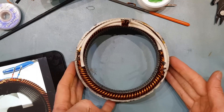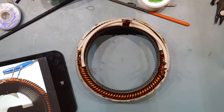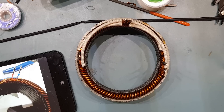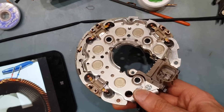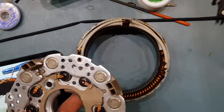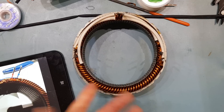So this is now a 320 amp alternator. Total cost: 50 cents worth of wire. This was a 150 amp Toyota alternator off eBay that cost I think $130 US. It's got a decent quality rectifier using 12 50-amp diodes, and they're Elton diode brand, which is what a lot of the decent quality aftermarket parts use. So does anyone want a video on reassembly? If you need a video on reassembly or would like one, just leave a comment in the comment section and I'll see what I can come up with. There are a few things you need to be aware of, but if you get to this stage you can probably figure it out on your own. See you.